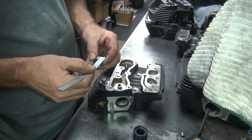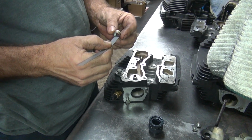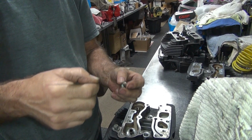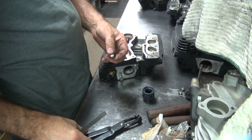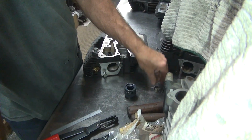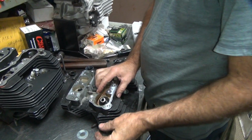And this is 450. So that's 150 roughly built up above the stem height. It used to be when they figured 100, but they've been getting taller over the years. It's about 285. It's 430. So 85 to 30. That's about 150. Yeah. So we need 150 above the valve stem plus clearance. You should have at least 30 minimum. That's absolute minimum is 30. So that means we need 180 over the top.